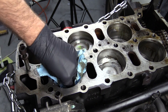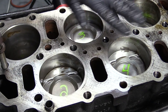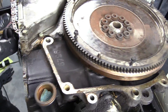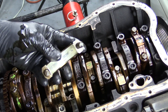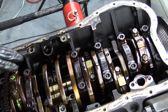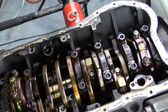Of course, we need to remove any dirt or oil. Now that we have all of our pistons marked, I'm going to roll the engine over and we're going to start taking the pistons out. You may remember we had one bearing that was pretty nasty — I never actually fully put this bearing back on, so we're going to start with that piston. Luckily for us, it's already unbolted. We're also going to remove the crankshaft as well, but before we do that we have some other work to do. We've got to take the balancer pulley off and the flywheel off because we need to get access to the bolts. So we're going to start with the pistons.